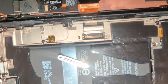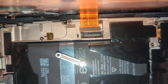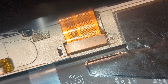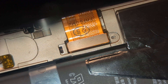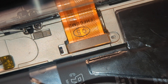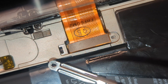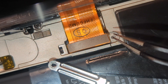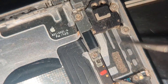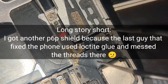Is somebody still there? Okay, if somebody wants to see this — it seems like the knockoff screen has some issues with the connector because it doesn't fit properly in the phone, so it keeps disconnecting. This thing is really hard to put in. I lost the screw — actually it didn't come with a screw, I found some glue holding the connector, not an actual screw. So I need to find some screws and check if the thread is the same.